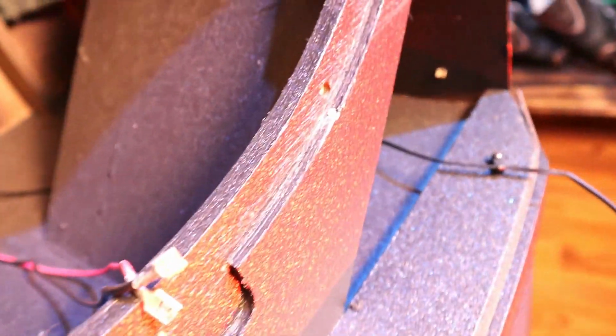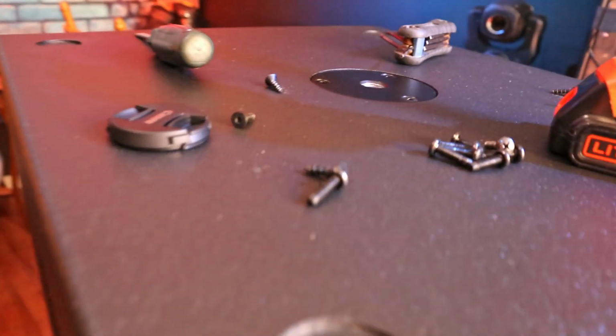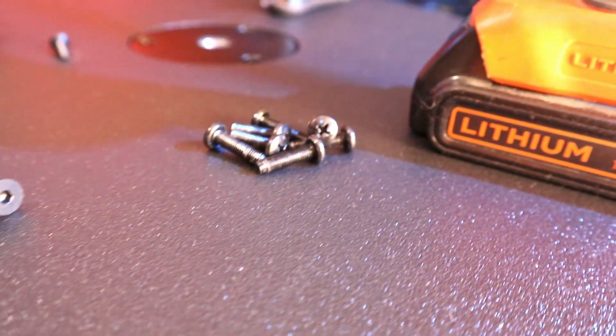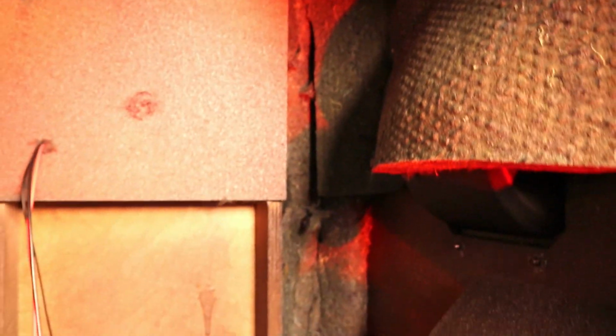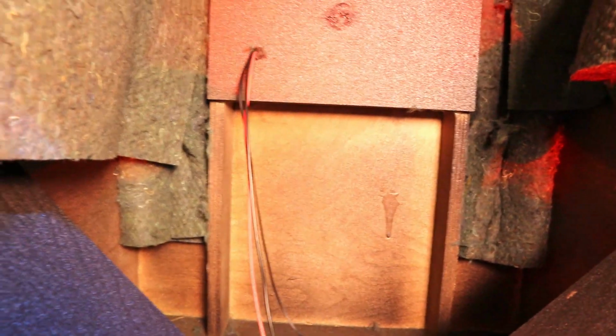15mm plywood, which isn't all that thick, I don't think. You can see it's a fairly thin flange for the sub. Luckily, it's got hardware on the back side for the bolts to screw into. Nice sturdy threaded mounting bolts. And as you can see, it's pretty well insulated, top and sides. And again, that's probably because it's not the thickest material for the case in the world, so they got to insulate it pretty good to help cut down on that boominess.